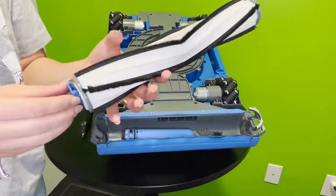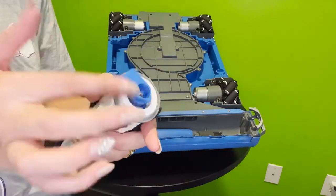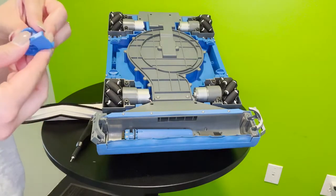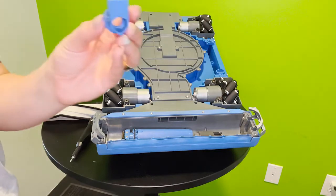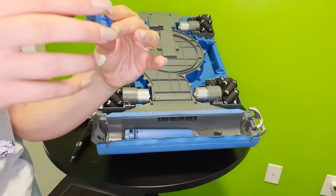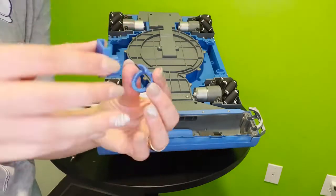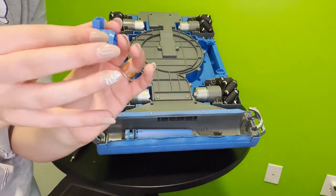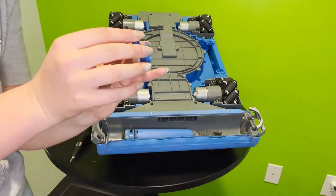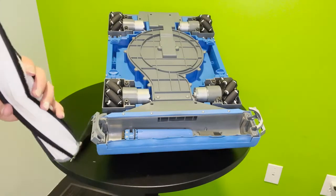And as you can see here, standard roller with hair mitigation systems in gray, meaning that we tried to build a roller that wouldn't have hair all over it. However, that still happens often, and it can sometimes jump those barriers into this other bearing as seen here. Again, if this bearing can do a 360, it means that your robot can still do its job and use the roller. But if it's getting a little sticky, you can just unplug this bearing here. It is pretty passive, there's no electrical component to it, and it does take a little bit of work and even a prying tool like a flathead screwdriver to get out, because it is pretty firmly anchored to the roller.